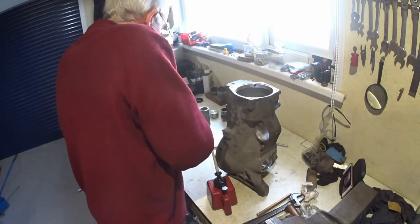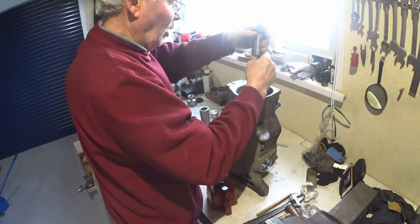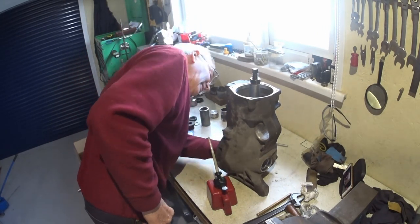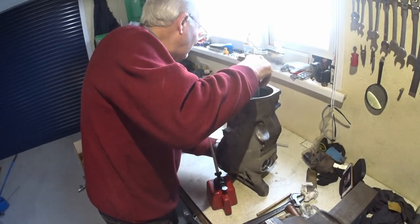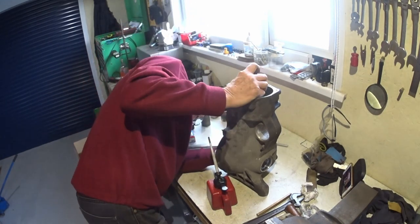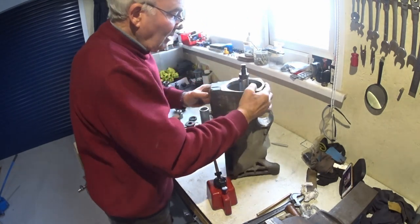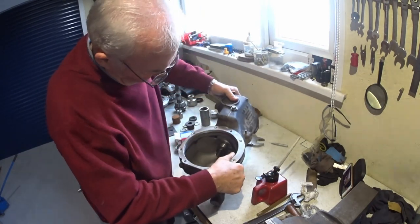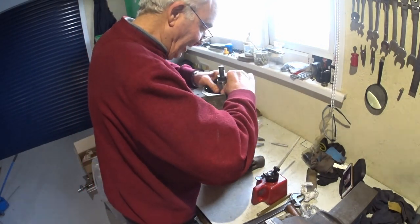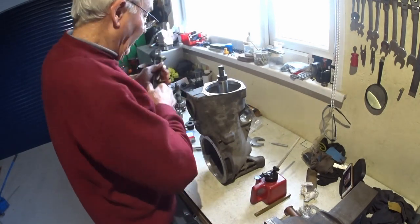So that's going to sit on my outer race. Bit of tubing, washer, etc. And then the same washer I had for the underside. It's going to hold it and centralize it off the bearing that we've just put in at the bottom. It looks good from there. Obviously you can't see what's going on now because it's buried down inside, but it looks square enough. So let's give it a try. Let's get it going first.